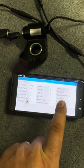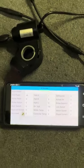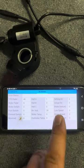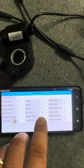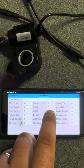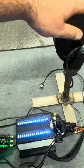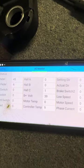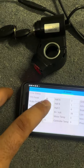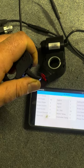In the app you have two options: AC Calibration and AC Monitor. When you press AC Monitor it shows you data about your controller. Since you have a temperature sensor on your motor, it will show you motor temperature, controller temperature, battery voltage, and the hall sensor lines — showing if they work and which direction they're going. If you spin the motor, those numbers change. TPS (pedal) shows your throttle — if you press a little bit, the number increases.